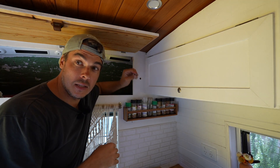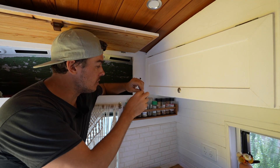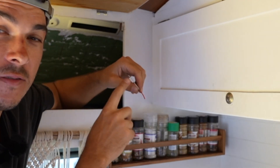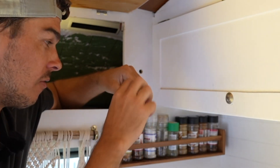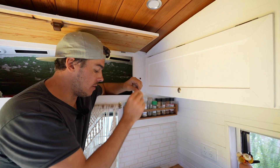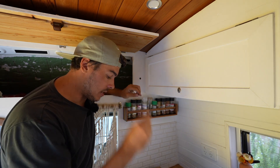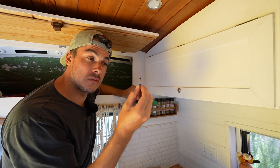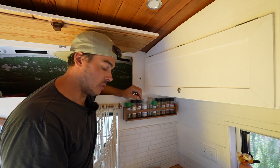If you are doing something like this, it's worth noting that the Starlink cable is a little bit different to normal double strand cable — there is a positive center and then a sheathing around it which is actually the negative. So when you wire it up, just be aware that the center one is actually the positive. I'm going to use crimp quick connectors to connect all the cables up, and then cover some of the exposed connections with heat shrink just to stop any chance of shorting out.